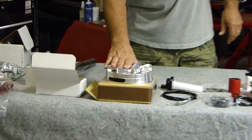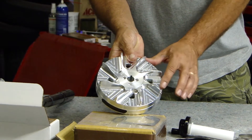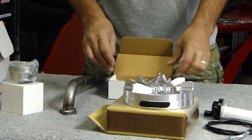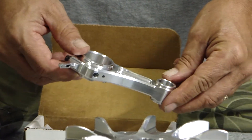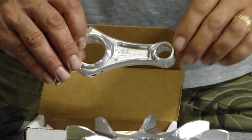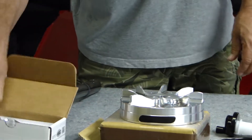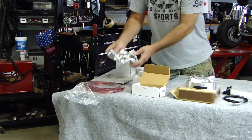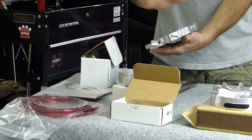We're running a slipstream flywheel — these are built in with 34 degrees of advance. I happen to run this flywheel on two other motors of mine, I'm very happy with it. Next, we got a brand new ARC rod. When I look at these things, they're like a piece of art — really well made, well machined, they hold up 9, 10, 11,000 RPM sometimes. Just a real good piece of engineering. All new fuel line to plumb the whole thing. We have a dual bearing ARC side cover as well. I really like these — one for the bearing and the way it seals with an O-ring, they really work well.